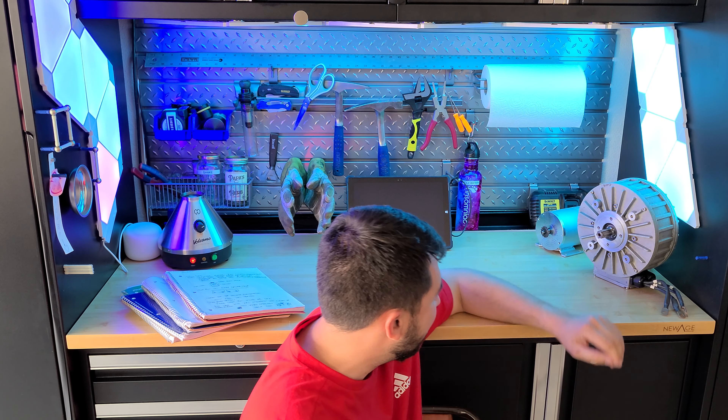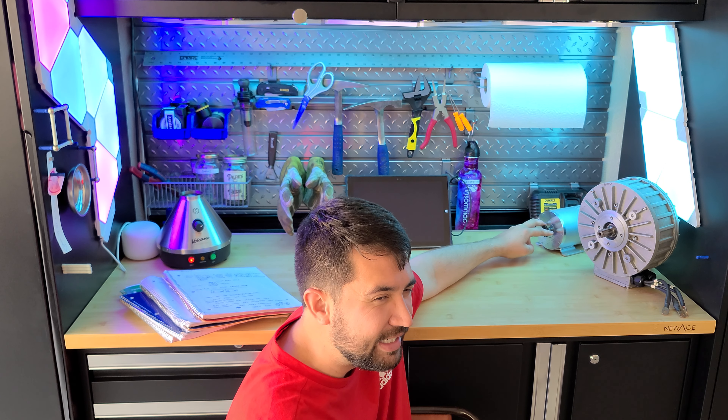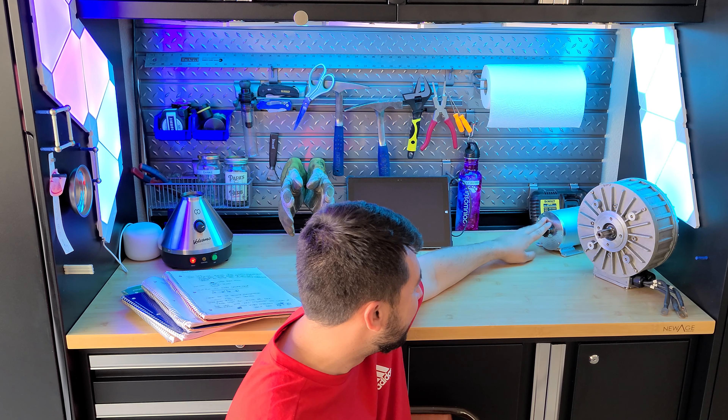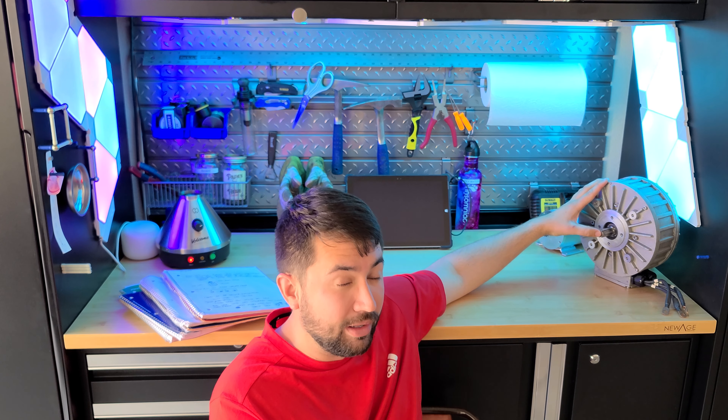I have a rough idea of what the next scooter is going to be. We're going to be using this two kilowatt motor back here - it runs at 72 volts and I have a matching speed controller for it. I can't remember the exact sprocket size but we're looking at a gear ratio of around 16 to 65. It's gonna be pretty ridiculous - I'm looking forward to it. I've never done a chain-driven system before so that'll be fun. I've started building a frame but it's a really junky design right now, just to test it out.